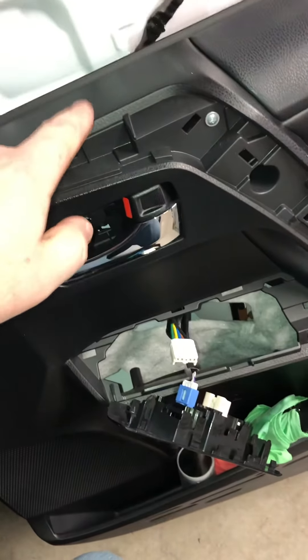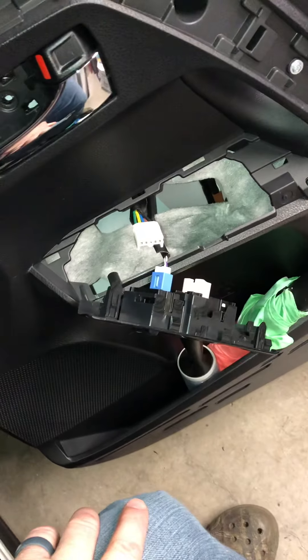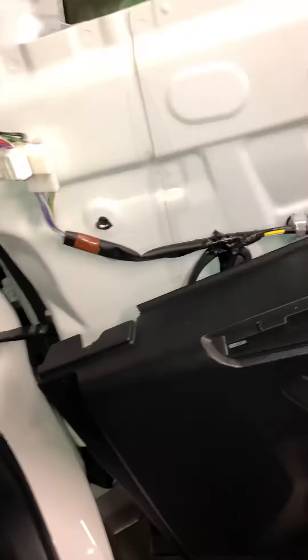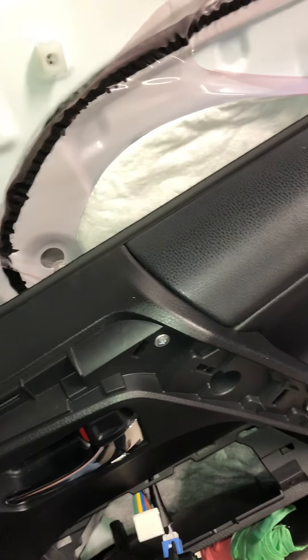Then we'll just reverse the order and put it all back together. When you put the door panel back on, set it up on top here in the window ledge, and for the bottom just give it a couple good palm strikes to get those little clips hooked into the door frame. That's it, guys — pretty straightforward, pretty easy. Just take your time. No fancy tools: you need a Phillips screwdriver, a 10-millimeter ratchet or nut driver, and a kitchen plastic tool to take the trim off so you don't scratch your paint. Any questions, leave them below. Like and subscribe — thank you much, bye.